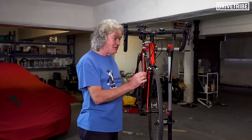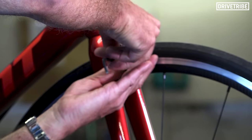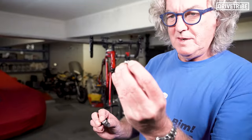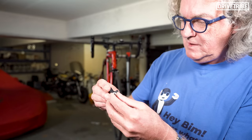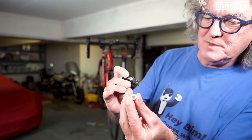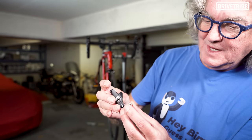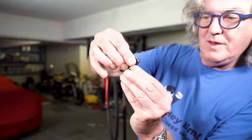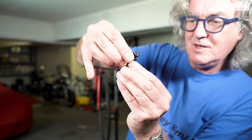First I want to show you something about the brake block itself. Let's take this one off — I might have to put my children's TV presenter glasses on. Here is the screw that secures the brake block, and here is the block and shoe assembly itself. You will notice that portion is domed and this washer is cupped. There are various different arrangements of this. That little sleeve is also free to move very slightly, meaning even though the screw clamps that washer square to the brake caliper, the shoe can move in all directions — so you can get it square to the rim and you can also toe it in or out.